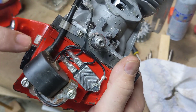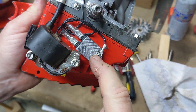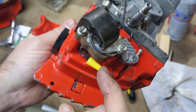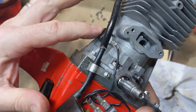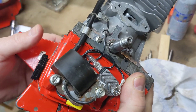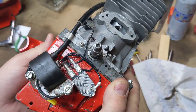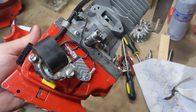Just double-checking our wiring: we've got our negative ground orientation here, we've got our positive from the chip coming back over to our junction with one wire coming up to our kill switch and the other wire going to the coil. That all looks pretty good to me. So we're going to put the flywheel on it, the magneto, and give it a spin and see if we can see some spark.